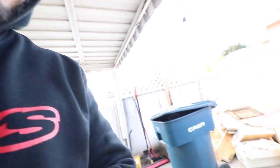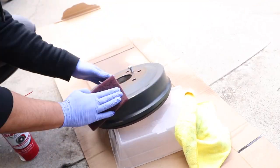This is probably overkill — I hit the whole thing with a wire wheel and used brake clean to clean all the dirt off. Now I'm gonna hit it real quick with just a red scotch brite to make sure I hit every single area. It's probably a lot of unnecessary work, but I don't want this paint peeling off later on. I'll hit it with scotch brite, then brake clean to clean it off real good, and then we can start hitting it with some primer.